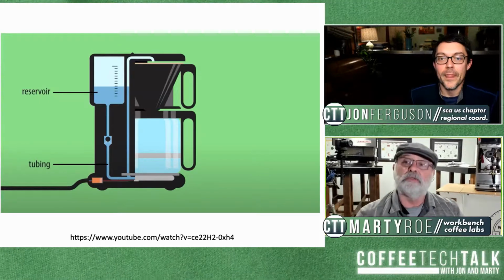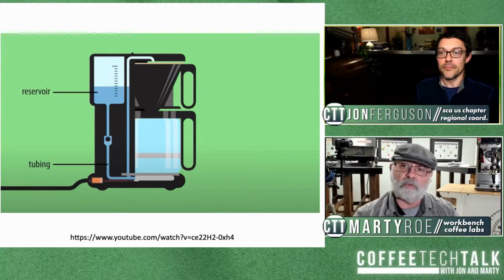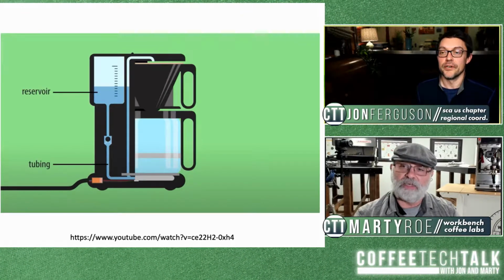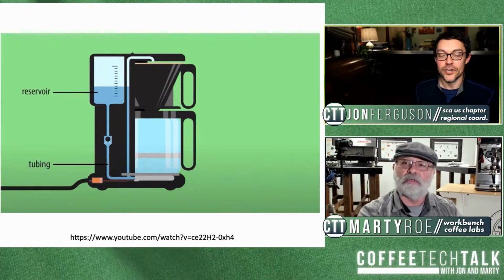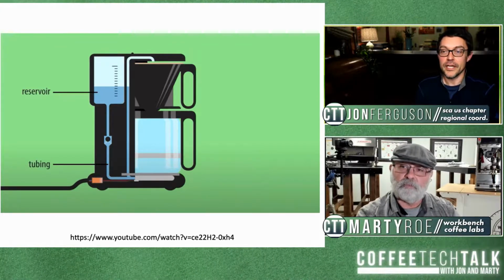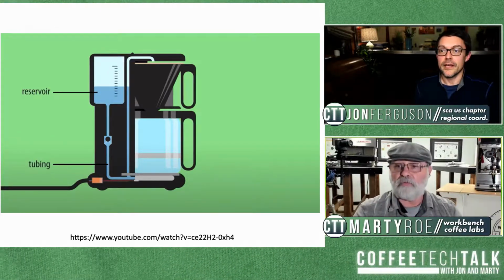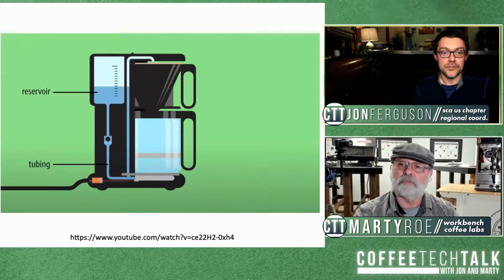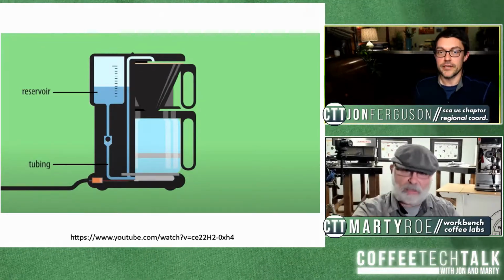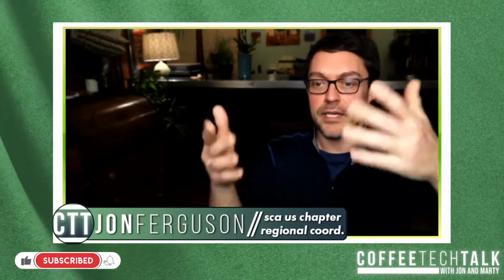And pretty soon you've got coffee. And you know what I wanted to do with this one? I was like, okay, how do I get the heating element outside from underneath the carafe, because I don't want to burn my coffee. I don't want a hot plate. So I'm thinking, what if I just didn't have the heating element underneath the hot plate? There are brewers like that, like Technivorm and Bonavita. The Technivorm has the same thing. It's a reservoir, tubing down, a heating element, it pushes the water up, and then it pours it over this little stem thing and it just kind of drips.